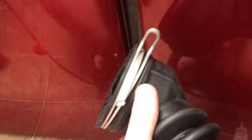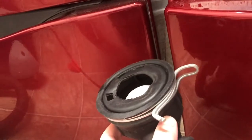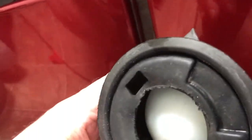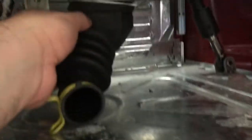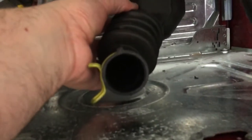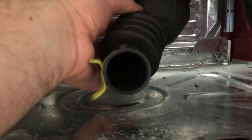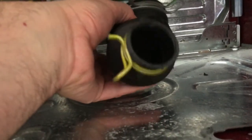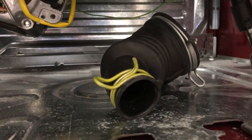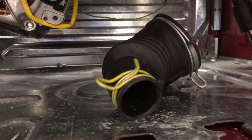It clogs the filter and then the pump itself fails. If there's something stuck in here — a sock, coins, really anything — it'll cause problems. I found in my impeller, impeding the actual magnetism, probably 11 years worth of sand from baseball. I'm going to be putting the pump in and moving forward — you'll see pieces of the drum housing, which is normal because it starts to shake and the ceramic coating chips a bit. So I've put waterproof grease on the little prongs, especially the one that mates into the housing.